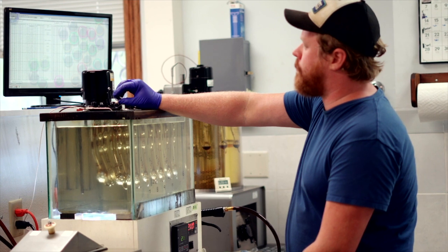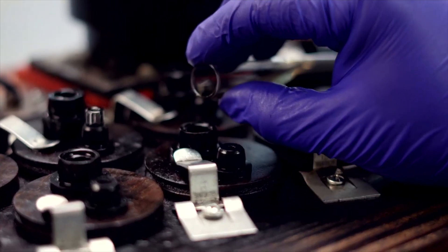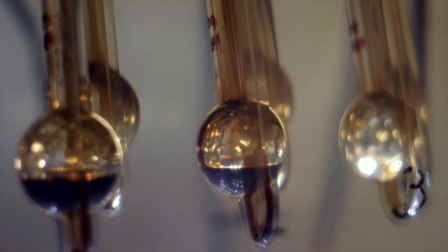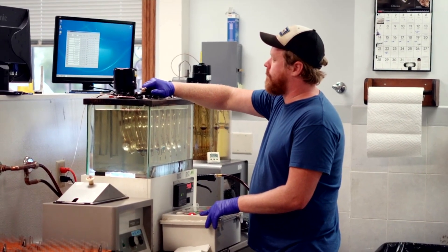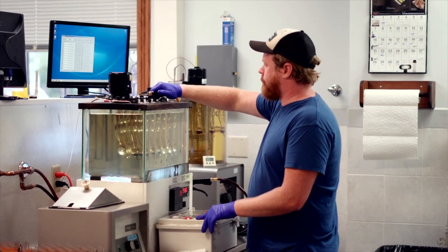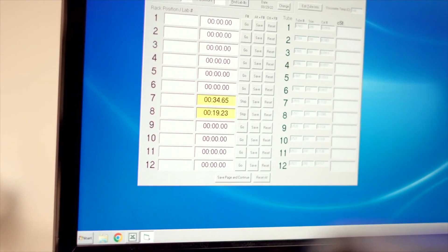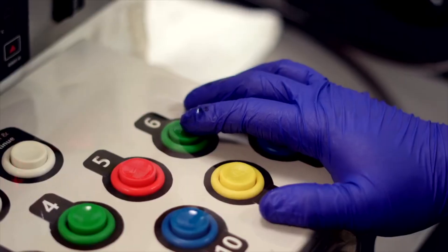What we're looking at here is a video of the viscosity test at Blackstone Laboratories from their YouTube channel — link to this video in its full length is below. This is exactly what they did to figure out what the viscosity of the oil was. It's heated to 100 degrees Celsius — 212 Fahrenheit — and they basically run it through what looks like a glass tube, and the time it takes to go through the different diameter tubes gives them an output of viscosity.